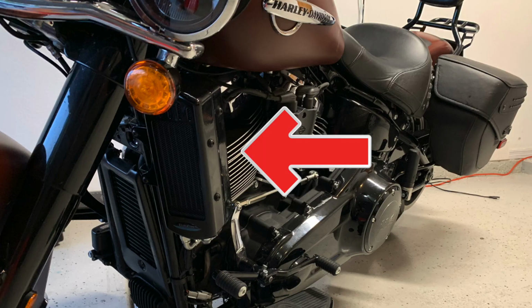So when I got home and I took that reading and saw 230 degrees, that was kind of staggering because I know that I've been in much worse traffic on hotter days where the temperatures were over 100. And I can only imagine that oil probably does get up to the 250 range, and maybe even north of that. I don't have any proof of that, but the readings that I took on a 95-degree day, 230 degrees. So I then went and installed this Ultra Cool oil cooler. The test I ran today, incredibly promising.